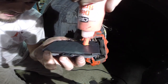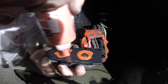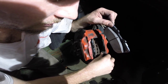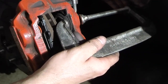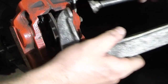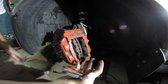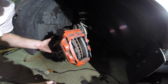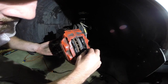The pistons are still compressed, which makes this job a lot easier. I'll slide in the rear pad now, get a little bit of this red miracle lube, and line up the holes. Looks like I might have to compress the piston a little more on this side. Let's get this one a little more compressed. Now let's slide this baby in. I'll just wiggle the rotor a little bit to give more room. Alright, we got them set in place — now we're going to move on to the hardware from the little goodie bag they supplied.